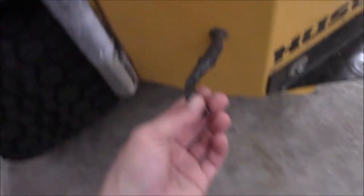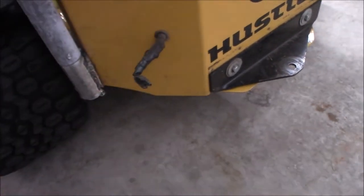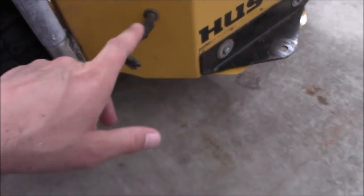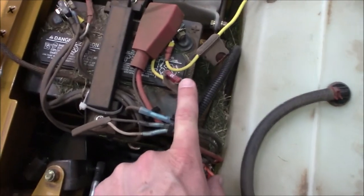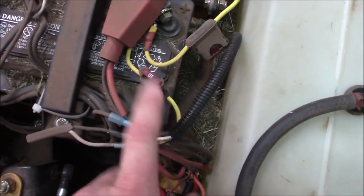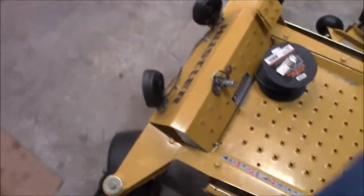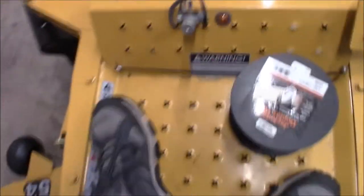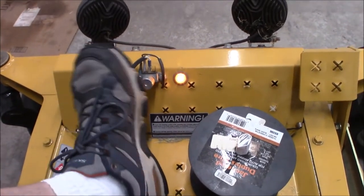The other wire is back here. If I want to plug in the tow-behind sprayer right here, instead of having to run the long wire up like normal, it's got the switch in line. I actually put that foot switch up there, and it is also fused right here — 10 amp. I should never draw more than 10 amps out of that. Then running up to the front so I don't have to wonder whether it's on or not, we have an indicator LED — nice and bright. We know power's on back there, or now we know power's off.